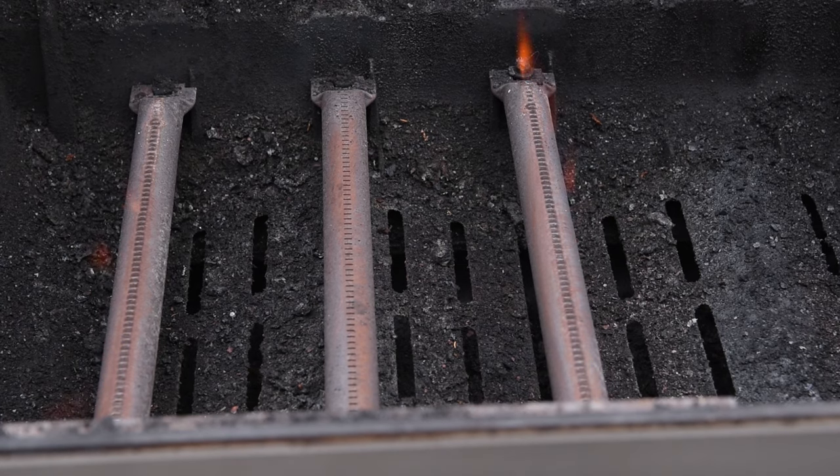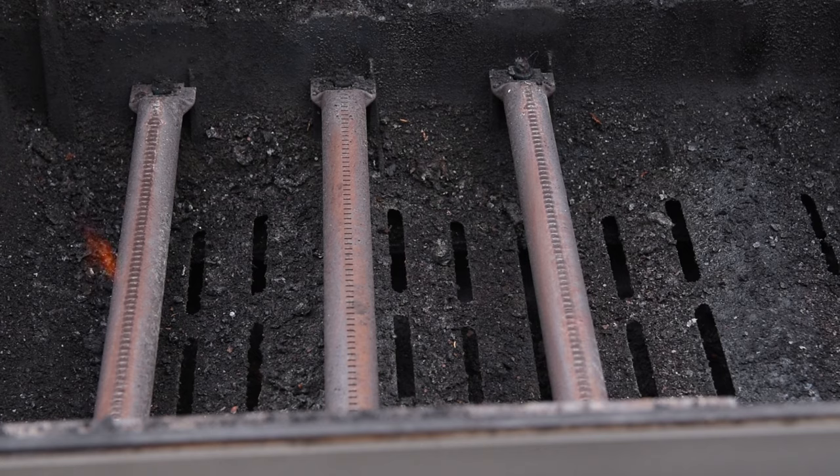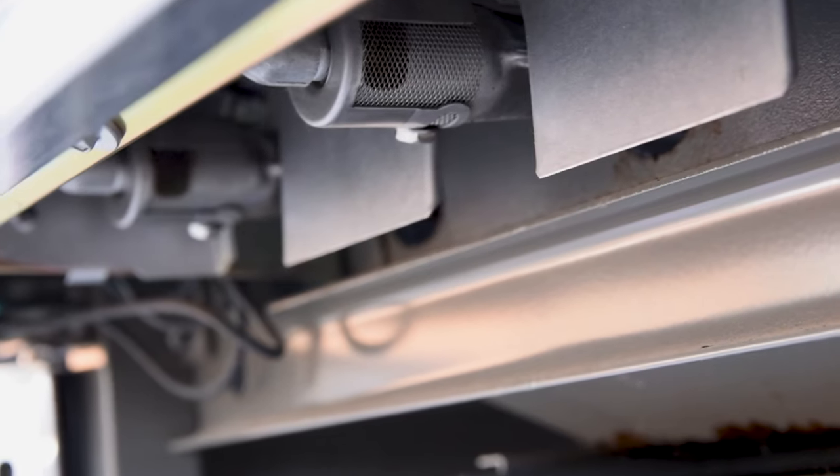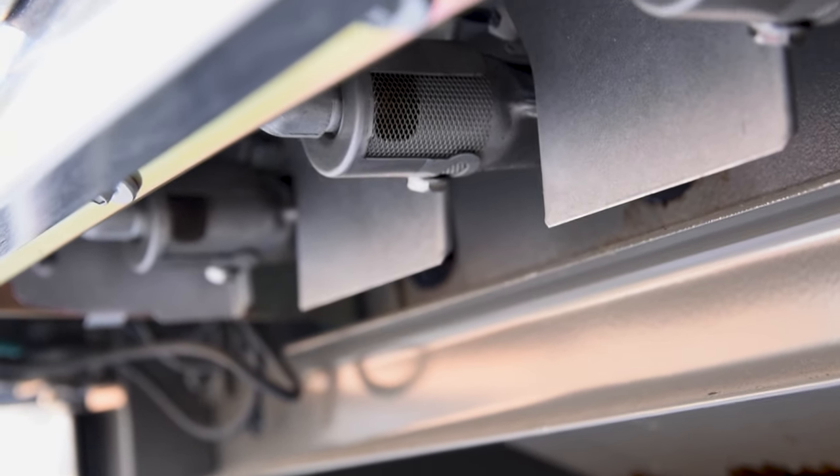A better test is to light the burners and look at the flame. Constant yellow flame indicates a problem with the burner or the air-fuel mixture. These are a nice blue after the initial burn-off, so we're good to go. If yours are yellow, you could check the screens at the end of the burner tubes and clean them with a soft brush if a spider made a home and blocked them.